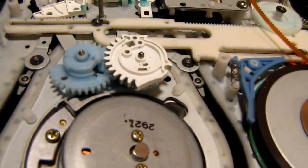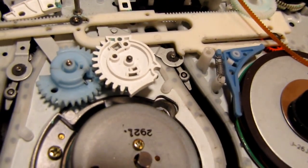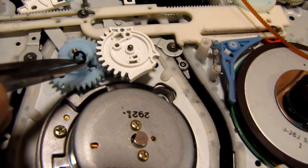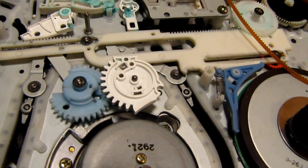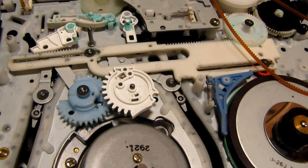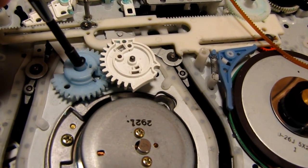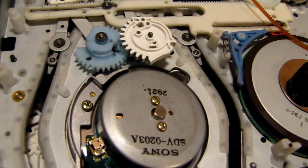What I'm doing to put these small clips back on is using a nut driver, a small nut driver. So I put the... I hate these little things. I'll put that in place, more or less where it goes. And the nut driver I'm using is a 7/64ths, believe it or not. And I just put that over the top and pop her down, snap them in place. And I've used that for all of them.